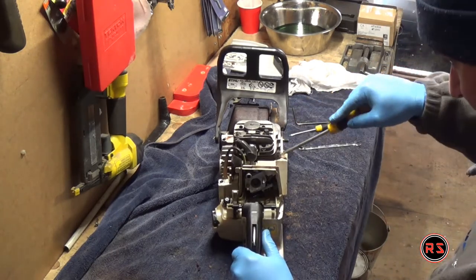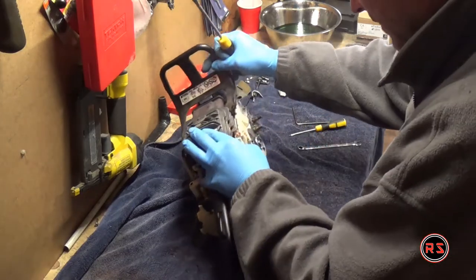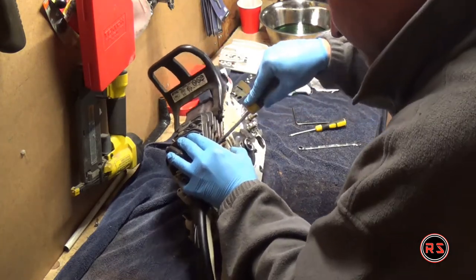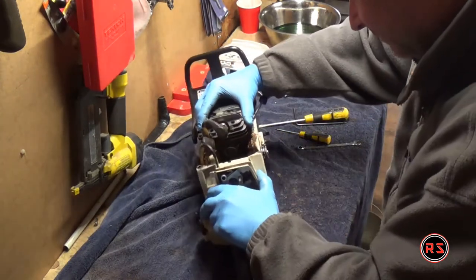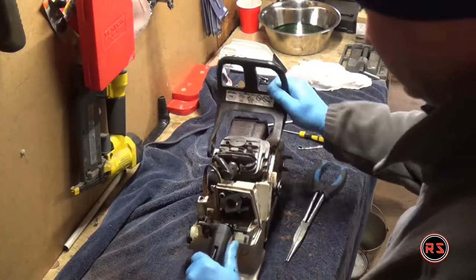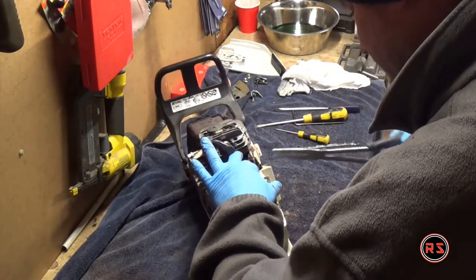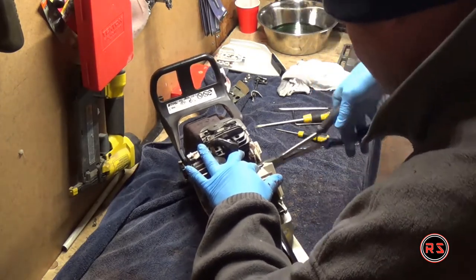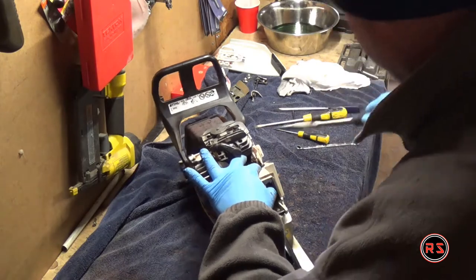There's no magic in it and no special tool is required — only a lot of patience. If you want to pry on the cylinder head to pull the neck out of the cylinder gap, you need to be careful not to pry too hard and break a ventilation plate from the cylinder head, because those plates or fins are made to dissipate heat from the cylinder. If you break one or more, you will have overheating problems and might blow up the engine.